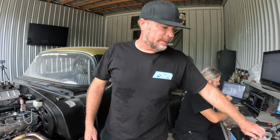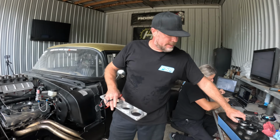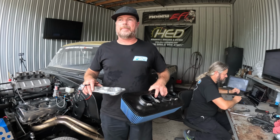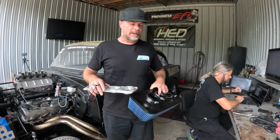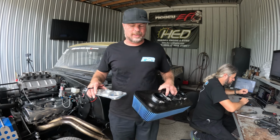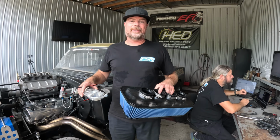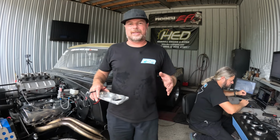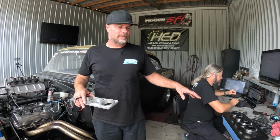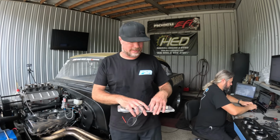Years ago, the folks at Walker Performance Filtration, who I met at the PRI show, custom made me this air filter for Blasphemi. And I chassis dynoed it once and it did pick up power. I never got to back that pull up, but ever since then, I've been driving on the street with this and then taking it off the track, not knowing what it was gonna do to my tune. We have a little time now, so we're actually gonna bolt this on and see, does this help? It's not a true A/B test because he is trimming the fuel map just a little bit, but in theory, because it's running in closed loop, that shouldn't change the power that much. So if we do see a significant change, it should be from the air filter.